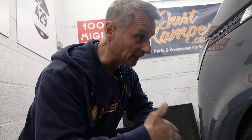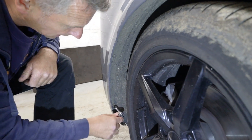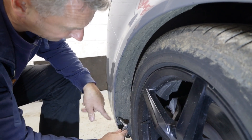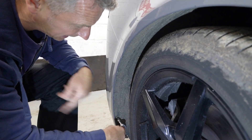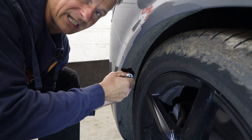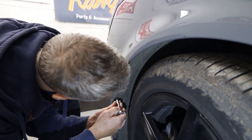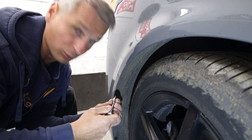Our poppers are now out from the front of the top of the bumper. Next is to get to the tip screws, which are in the wheel well. I've turned our wheels in slightly — turned them to the right because I'm on the left hand side — and that gives me a bit of access for my tool to go in. This is a T25; I've just got it on a ratchet to make life a little bit easier, but you can use just the screwdriver version. As you are taking things out, it's a good idea to pop them in a tool tray so we don't lose any screws.